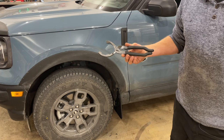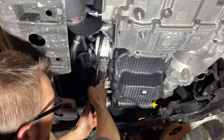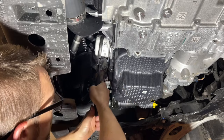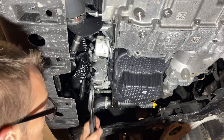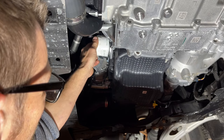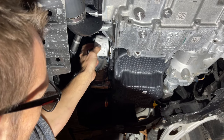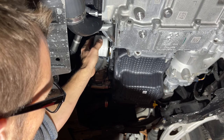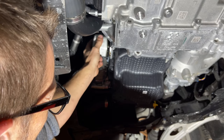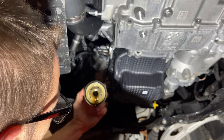One additional tool I forgot to mention is an oil filter wrench. We'll turn it counterclockwise — make sure you have your drain pan ready. This is actually a really accessible filter, which works out great for the filter wrench. Sometimes they're buried in there and you can't swing the wrench, but this one was very easy. We'll go the rest of the way by hand. You want to make sure the original gasket comes out with the filter as well — you don't want to double gasket it. And there's our gasket and filter.